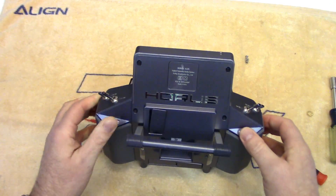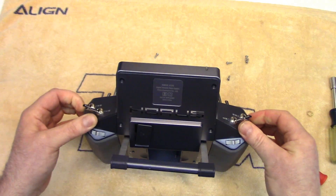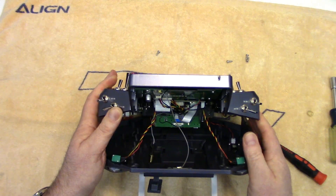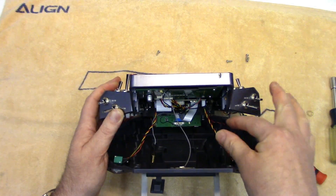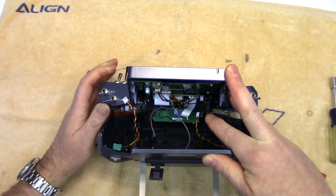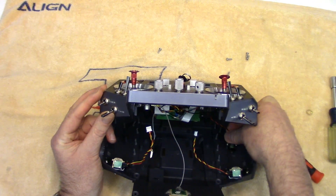To open this up, I just usually get my fingers on the side of the silicone grab pads here and kind of push back. Now on the inside, there are a few connectors we have to take off. Your two rotary dials on the back — you're going to have to unplug those. It would be best if you had some pliers or something to get in there. Just unplug those, and then your vibration motor is down here — this plug here. Unplug that.